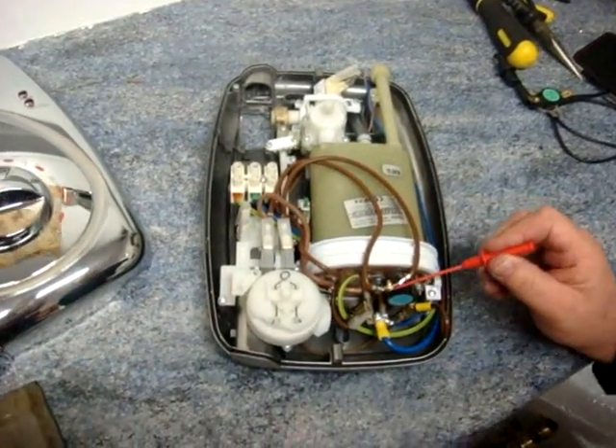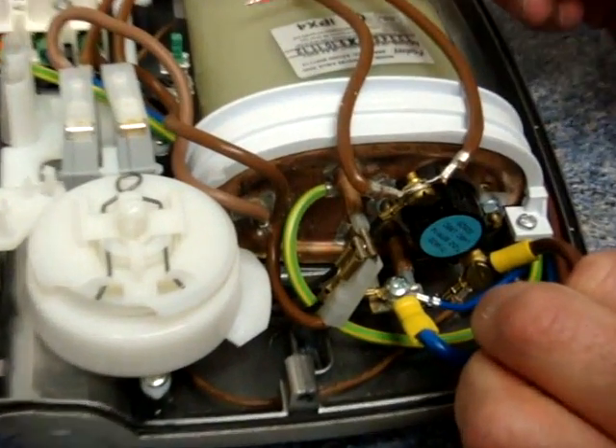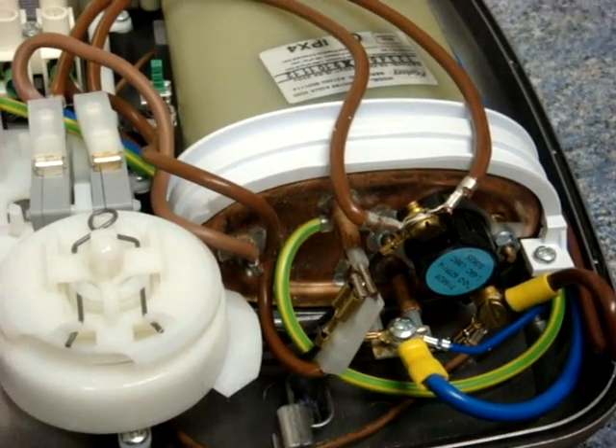This is the TCO here. You'll usually have one wire coming from the inlet connector, and the other one going off to the switches that control the elements. You'll see this on top of most showers.